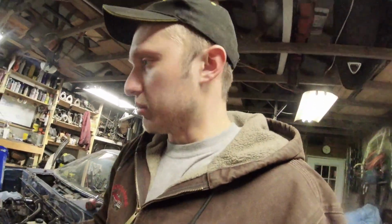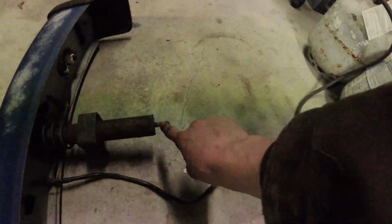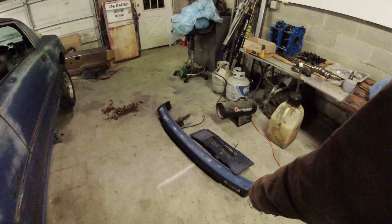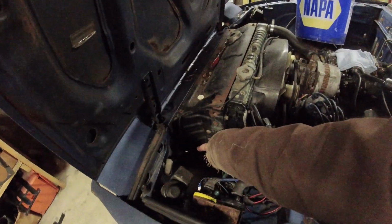So, I went ahead and stripped the front bumper, which you saw. A couple tips and tricks on pulling your front bumper off. There's a bolt down in here, okay, behind the battery and then behind your coolant overflow. And that is this one here. So it's the back of the bumper support. You have to get that off. There's two bolts that hold them to the front of the frame horns. There and there. The turn signals, the wiring actually runs through the bumper, so you want to just disconnect those connectors also by those little studs. Bumper slides out. Huge win.